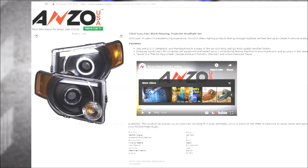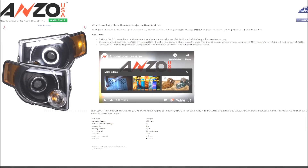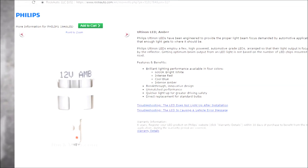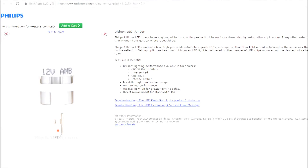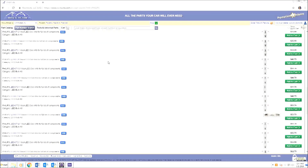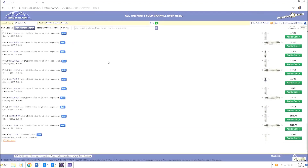Everybody's upgrading today and it's an exciting time. No matter what age your vehicle is, you can get new complete headlamp assemblies with LEDs that change the styling and illuminate better. You can get new bulbs for almost anywhere in your car — courtesy lights inside, license plate light, turn signals, brake lights. Especially instrument cluster lights: you don't want to replace those more than once because you have to disassemble a bunch of stuff. LEDs last longer, use less electricity, don't generate as much heat so they won't damage the plastic, and they withstand vibration better. You do the job once, and you can choose different colors — blue, red — they just look good with the halos and everything. Stick around because there's plenty more Tech Garage presented by rockauto.com as soon as we return.